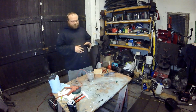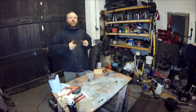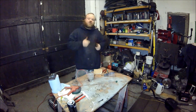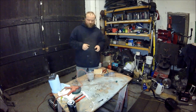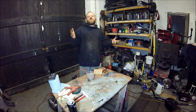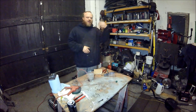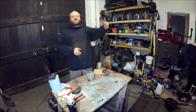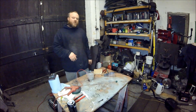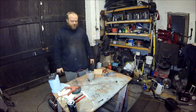The other downside is: say if you manage to capture that gas and store it, then inject it back into the engine to burn it, the byproduct of burning hydrogen and oxygen is you basically create water vapour. So what you're doing in theory is using voltage from the car to break the water apart into its gaseous forms, and then putting it back in the engine to burn it to create more energy. Theoretically, everything you create voltage-wise by burning the gas will probably be taken up trying to create the gas. You can't put 100% in and get 110% out - so theoretically this won't work.